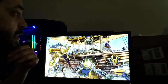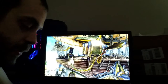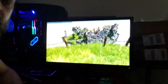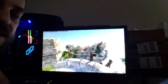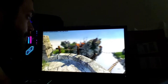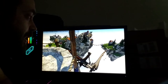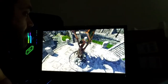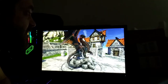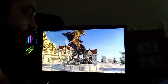And then I've been tinkering with the GFX core, which is what your graphics card is, the APU side of it. The GFX core I have cranked up to 1660 right now. I tried to get up into 1700, and I tried a whole bunch of different voltages and stuff like that, and absolutely could not get it stable at 1700. So I went back down to 1660, and I think I'm at 1.2875 volts on the GFX cores. So 4 gigahertz on the CPU and 1660 megahertz, I believe, on the GPU core.